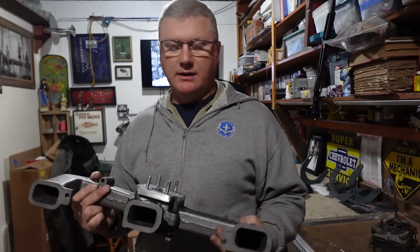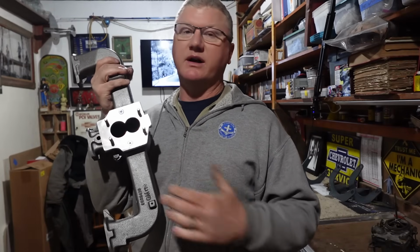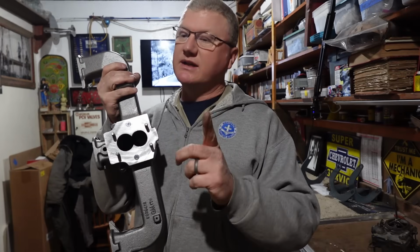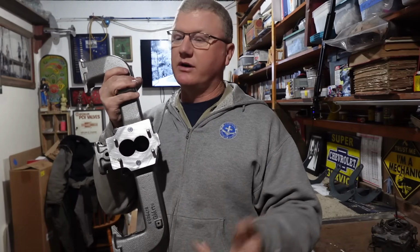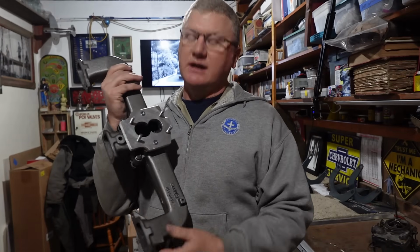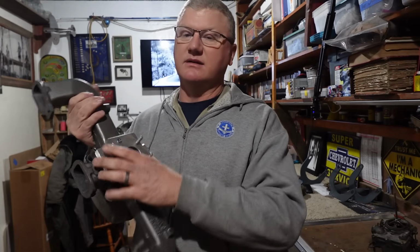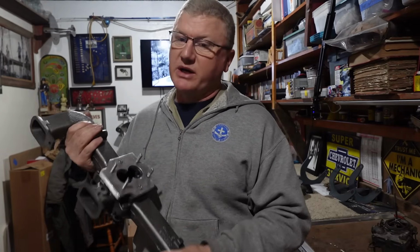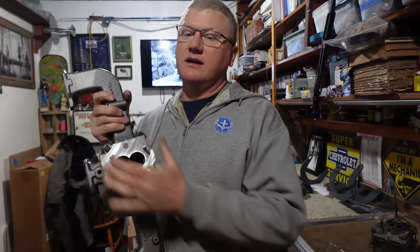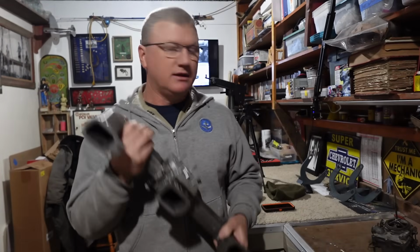Maybe, maybe not. Another option out there is on eBay. I believe it's sold through Mr. Hot Rod. He has his own website, or whoever it is, and I think he also sells it on eBay. I don't think it's 12 bolt, 12bolt.com, but I could be wrong. Maybe both places. But you can buy just the flange, a kit of just the flanges, and then you can get material and weld up your own manifold in whatever configuration and size and carburetor you want to make it. That's another budget-friendly option that I have considered, but I wanted to try this first with basically a manifold that was garbage anyway, right? And I think we accomplished that. We'll see how it works. You let me know what you think.